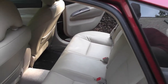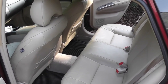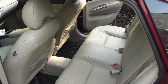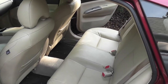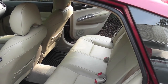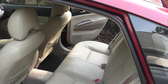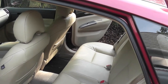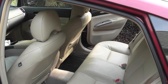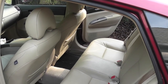Everything just popped back in and I think we're ready to go. I'm going to be driving it myself this week before giving it back to my wife, just to make sure there are no more check engine lights. I hope this video was helpful. I recommend that when you replace the battery — remanufactured or new — do clean out that blower motor fan, as it does get clogged and probably contributes to not getting enough airflow. I'm going to be testing these remanufactured batteries. I've got a 12-month warranty and I'm going to try to do more research to find out if they actually put in new battery cells or just used cells. I'm anxious to see how well this works out.